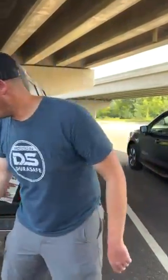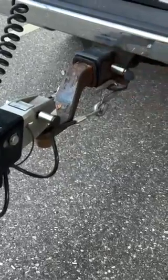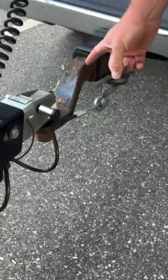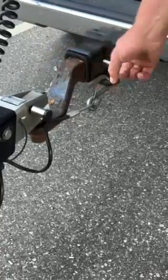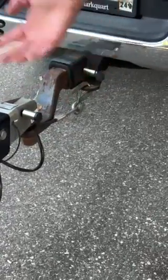Today's tally: three of seven people do not have both ends locked up. You really should think about having both your trailer lock as well as a receiver lock on, because if somebody wants to steal it and you're missing one of those two locks, they're either going to take the trailer off the ball or they're going to take the whole hitch and ball right out of the receiver. In either case, if somebody really wants to get your trailer or your boat, they'll do it if you don't have both locks.